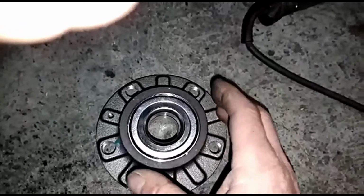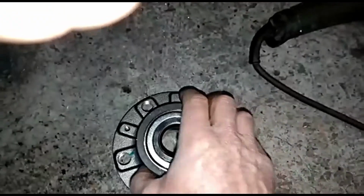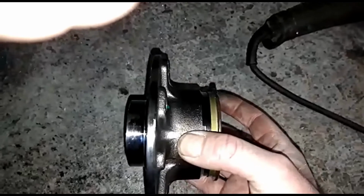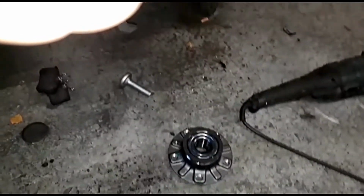Because clearly if it didn't have ABS and it locked, then all you're going to do is slide. So it's just cadence braking, as it's called, poor man's ABS. If you didn't have ABS, you used to put the brakes on and off with your foot, but this does it automatically. Anyway, I'm sure most of you knew that, but for those that didn't, there's a bit of info for you.